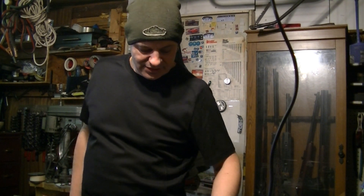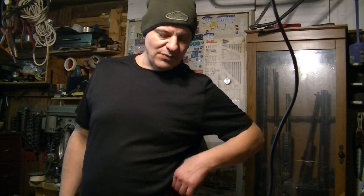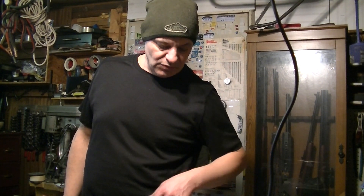As far as going in there with that, I would stick with a copper brush. Don't get too crazy with stainless steel on aluminum, obviously, because I only use the stainless steel on the surface to clean it up. I don't generally try to get on the inside, because it's not too good on brass either — same thing with aluminum — so you've got to be kind of easy with it.